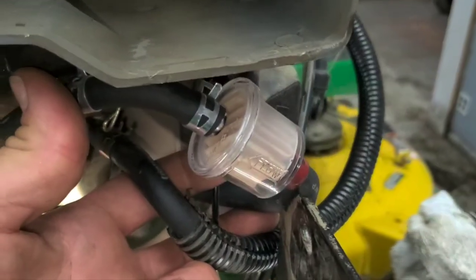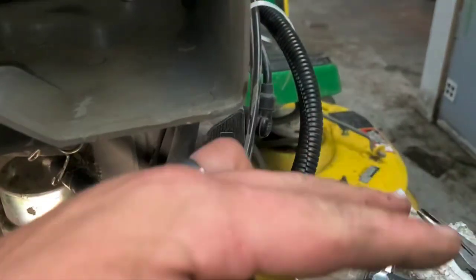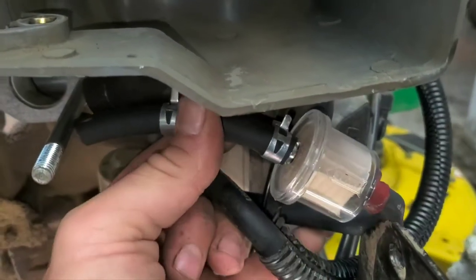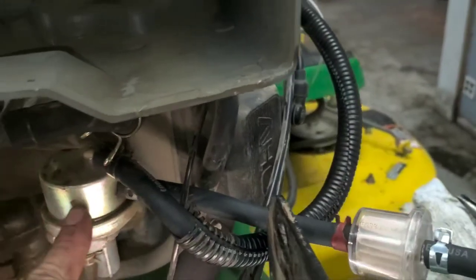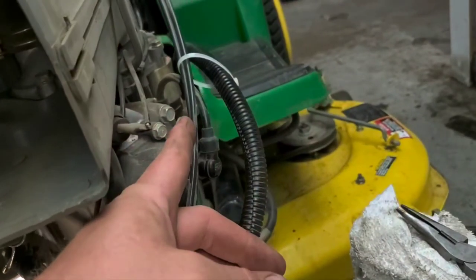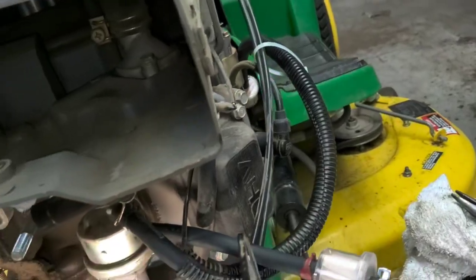So when those pieces break off, we leave just enough here so you're not kinking or anything like that. I like these Clear Flow 07-122s from Oregon, but just enough room there that it comes around here to go to the carburetor. Nothing's pinched off, and you're filtered again. So any of that rubber, if that rubber gets off from this fuel tank, you're filtered here again. So you don't have to do one here either if you want to only filter it once. That's fine too, but never hurts to have too many filters.